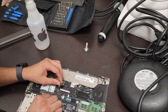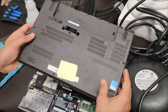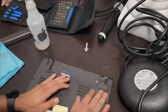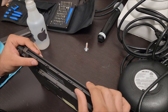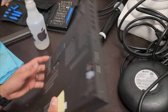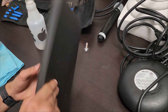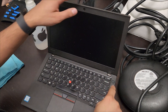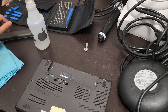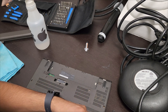Make sure you reconnect the battery connection, then put the back cover on — there's some clicking at the top and the center. Make sure everything looks flush. Before you screw everything back on, go ahead and turn on your laptop to make sure it's working — this will save you from having to unscrew everything again if something is wrong.